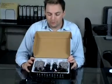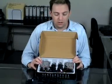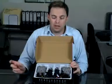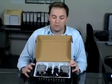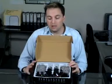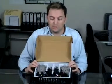If you don't run a CAN bus kit on a CAN bus vehicle, one of 4 things could actually happen. The less damaging scenario, I guess, is that the lights will flicker, and or you might have a computer error come up on the car's computer telling you you've got a blown globe, because it's looking for your typical 55 watt halogen load, whereas your HIDs are only 35 watt. The other end of the equation is you could actually damage the car's electrical system if you are running a non-CAN bus HID on a CAN bus car.